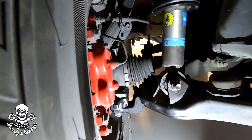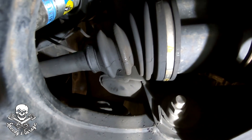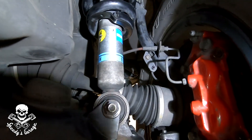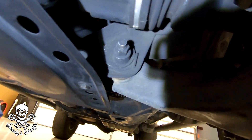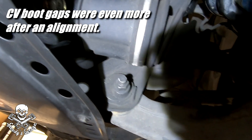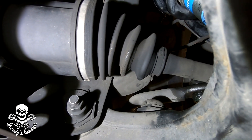Now let's take a look at the CV joints to see if they changed. There's the outer with it sitting flat — I don't see any ribs touching, that's good. The inner one is usually the one that gives people trouble. That fin is close — I'd say there's probably two millimeters of gap between those fins, but it is not touching, so that's good news. Let's check the driver's side. There's the outer — no fins touching that I see. Let's check the inner — it's close but it is not touching that I can tell. I can see light through it, so that's good news.